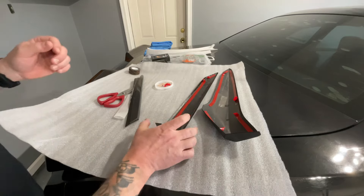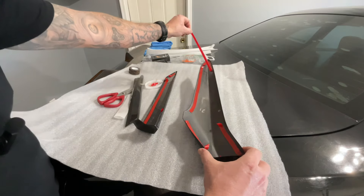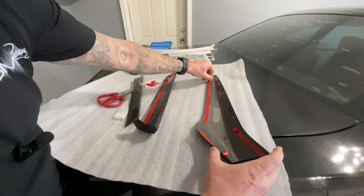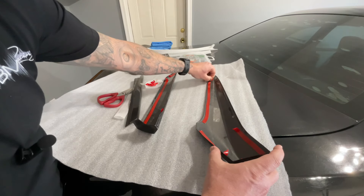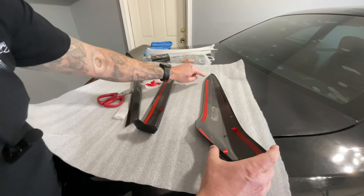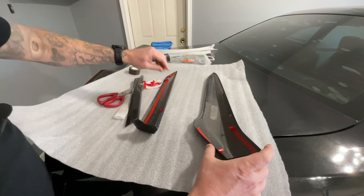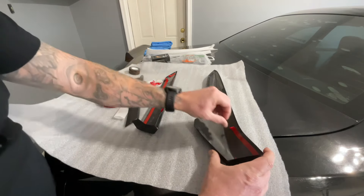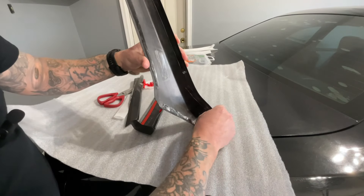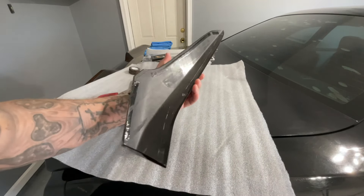Okay, just for the sake of time in the video, I went ahead and started the corners here for the two-sided tape. I just wanted you guys to see how I had taped this to try to get maximum coverage. Now, some of these pieces you can see I stretched them and kind of shaped them around — it is pretty malleable so you can shape it and move it around. I wanted a piece here so I could push it in against the back. All right, let's take it over and get the first piece on the car.